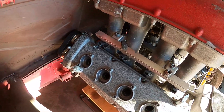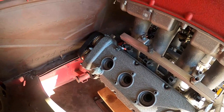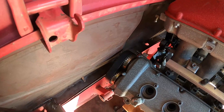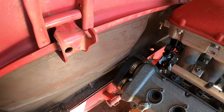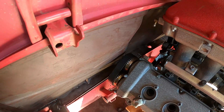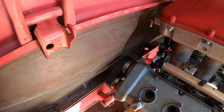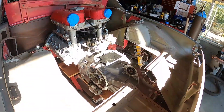Because of the cylinder offsets, the driver's side bank of cylinders — notice the cam gear sits a little bit deeper and a little farther forward on the engine. So pay attention to which side of the engine you're measuring from, because one side is going to have more clearance than the other. I hate those kinds of surprises.